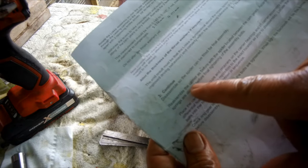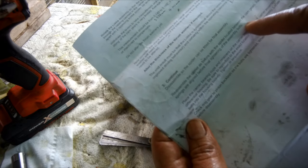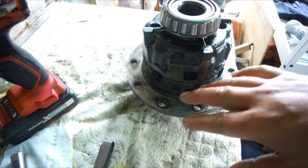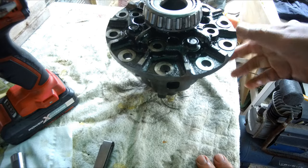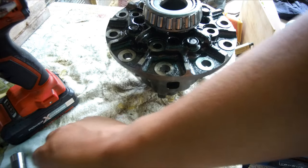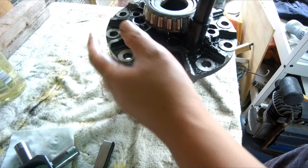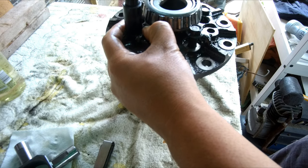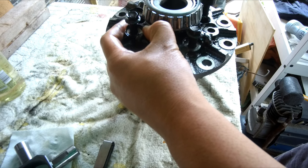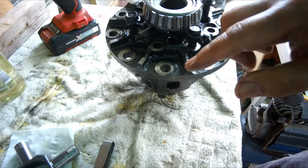Next is to reassemble the carriers as before, this time with a spider located between the cam gears. Make sure that springs are aligned before final tightening of the assembly bolts. So we will disassemble and reassemble the diff of the carrier using the final cross shaft. Careful as there is still spring tension in this.